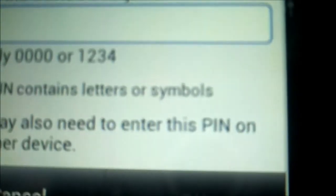After it's plugged in, the next step is to turn on Bluetooth. Go into your Bluetooth settings and search for devices — this is Android 4.0, by the way. There's OBD2 in the list. Select pairing, and a passcode prompt will pop up. The passcode is 1234 for this specific one bought off Amazon. Then it'll say pairing, and it's paired.